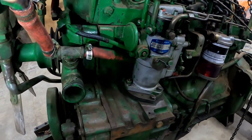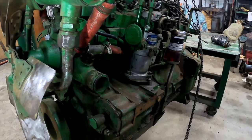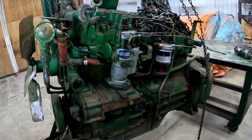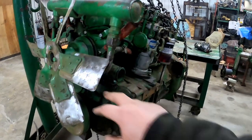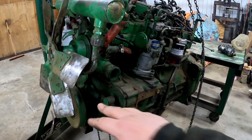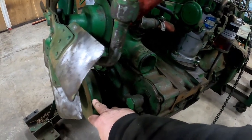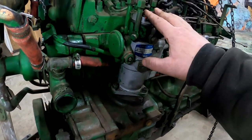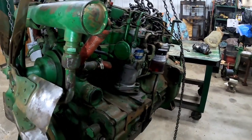To replace that, you need to make sure your timing's right, in which case you can open your window — but that's a big, long procedure that's not going to be in this video. That's why I'm telling you about the timing marks on all these gears: they only line up once — I think it's every 72 revolutions — because they aren't exactly two-to-one or anything like that. It ends up being two-to-one by the time you get from the crankshaft to the injection pump. The injection pump turns at half the speed of the crankshaft because it's a four-cycle engine — the piston only fires every other time it comes up.